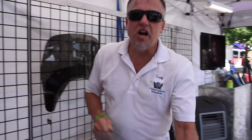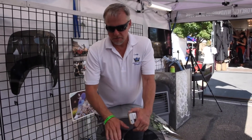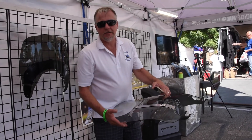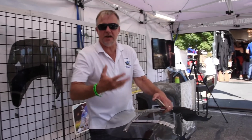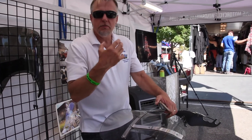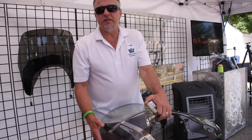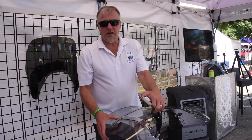We're going to talk a little bit about some of the cruiser windshields that we do. We do the replacement screens that fit right back into your stock brackets. A cool thing about the soft tails and the road kings is that we can actually create a quieter pocket by the way that we drop the windshield down below the fork and add a little width on the side. A lot of times you get air that rolls up underneath the windshield, hits the tank, fills in that void, and creates a lot of low-frequency turbulence and buffeting. This will actually help reduce that substantially. We've been selling a ton of these windshields. Come check us out at clearviewshields.com — you won't be disappointed.